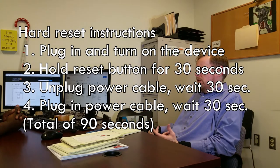I've only had to do that like 3 times in my life, but all 3 times it was able to extend the life of my device until I replaced it. What they told me to do on the phone was hold the power down for 10 seconds, unplug it for 10 seconds, plug it back in, and then hit power. None of that was reset button. Yeah, there was none on that. I never saw one on that.